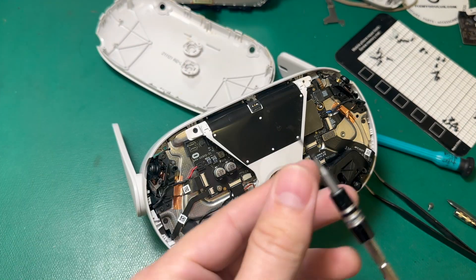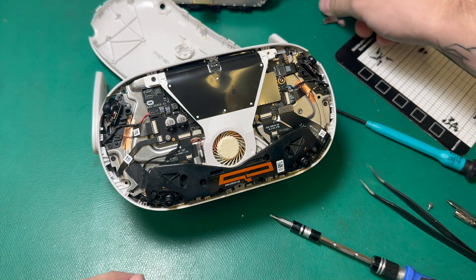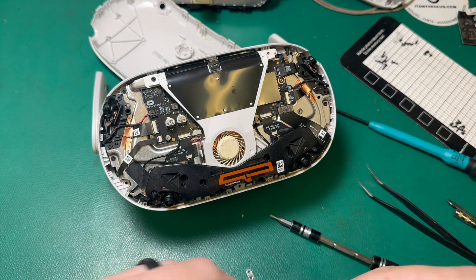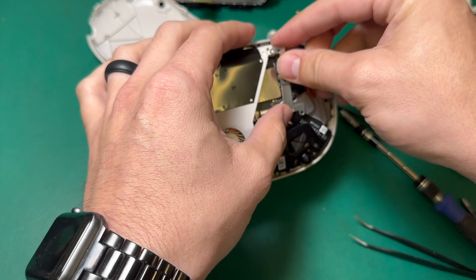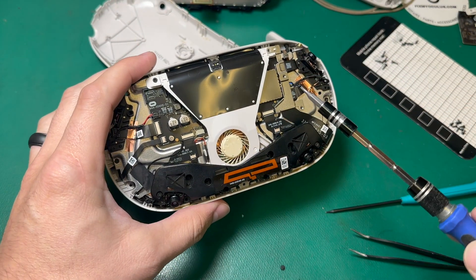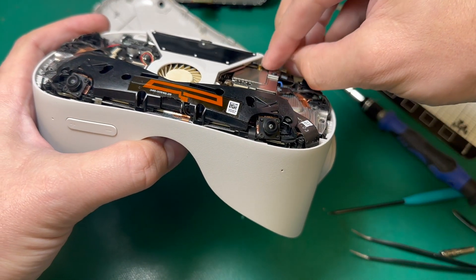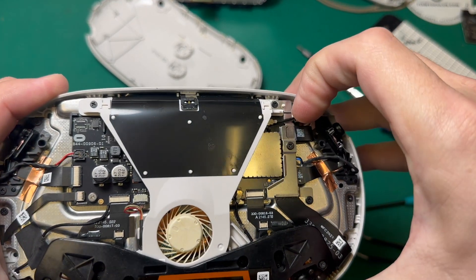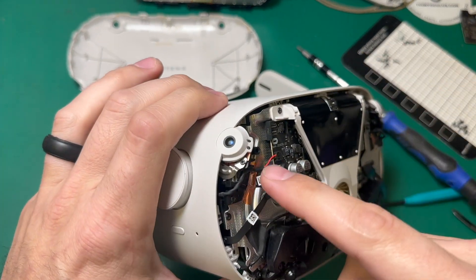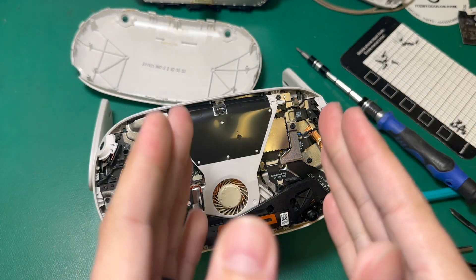Out of habit I usually put the long screws in first, but you can put these screws in any order. We're going to put the hex screw back in place, and then the retaining rod can go over the charge port and battery cable with one short screw here and another short screw. Finally, the last WiFi antenna clips back into the motherboard and we latch that in to hold it in place. The camera rings go back in — the one with two holes goes on this side, and the one with one hole goes on the other side.